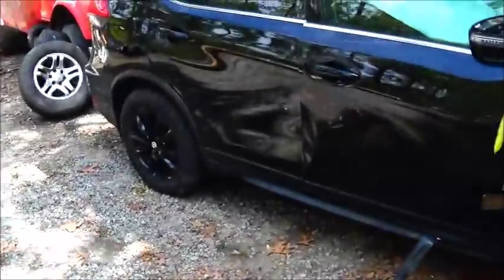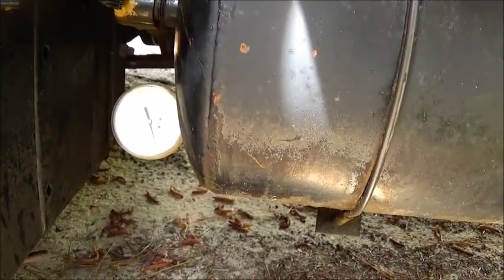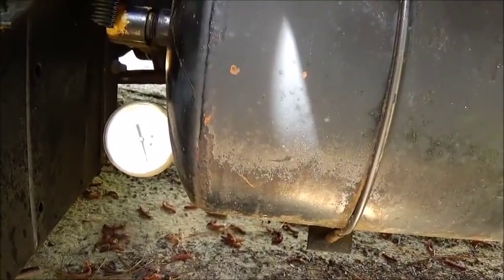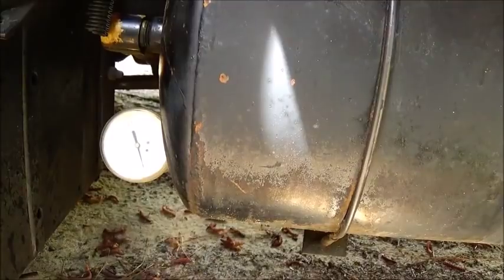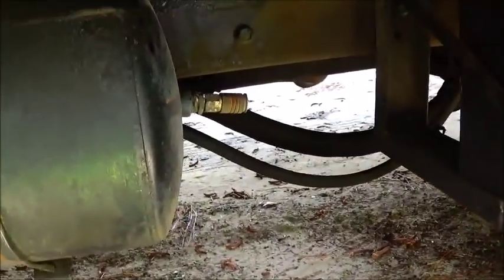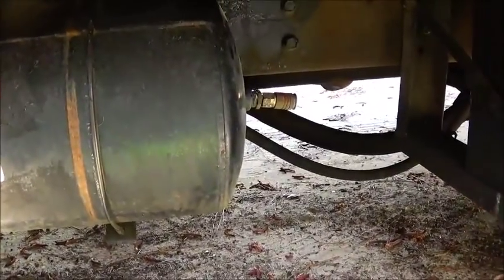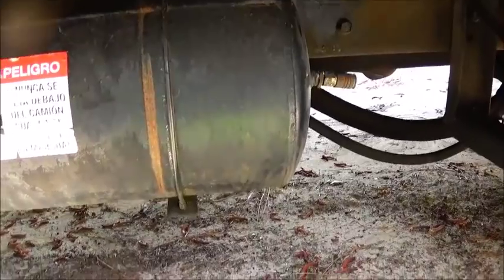On this truck, the pressure relief valve was popping. I had a pressure relief valve down where the gauge is at — it was set to 140. When I put the gauge in, it went up to about 130-135, then the governor kicked in, the compressor quit pumping, and at about 90 pounds it kicked back on — so it was working perfectly. I've got a pressure relief valve on top already, so I went ahead and left the gauge in. I've got a little leak where my air chuck connects to the air hose, but it holds air pressure fine when running.